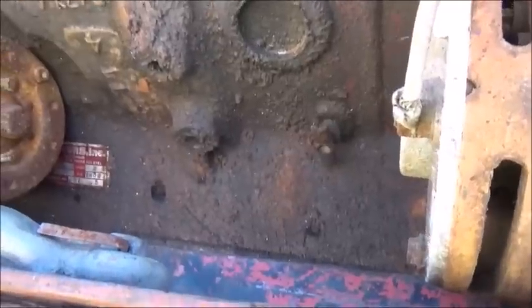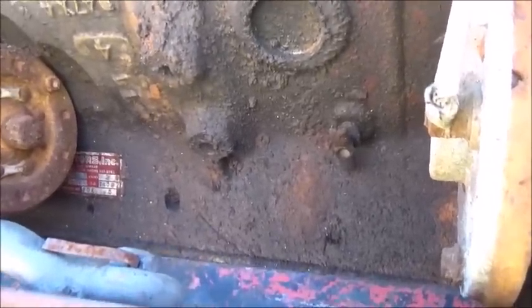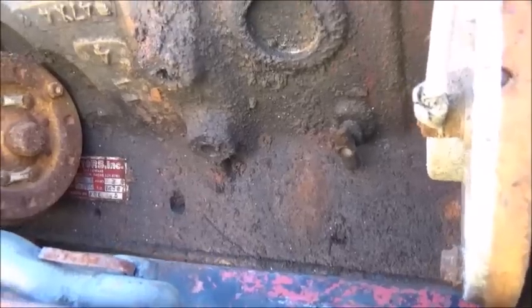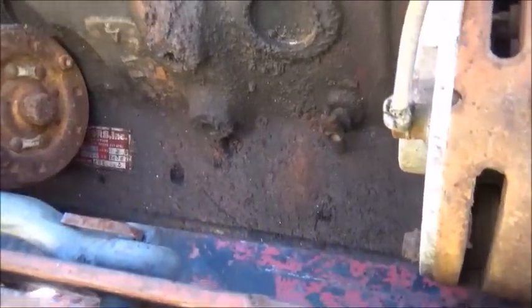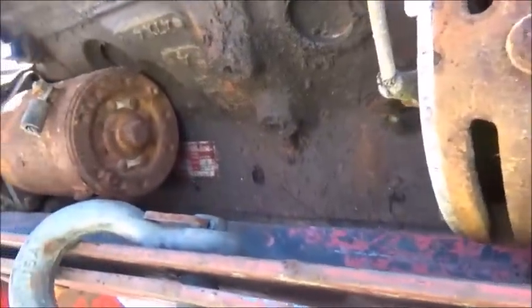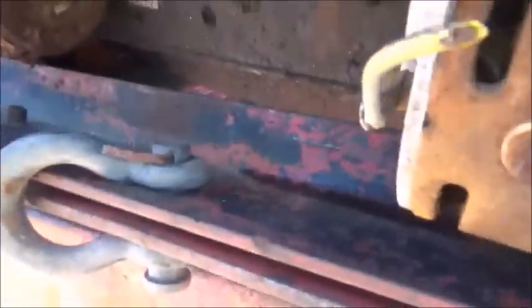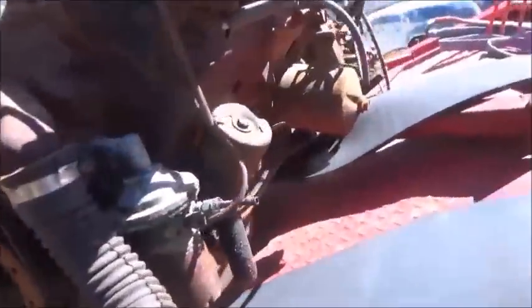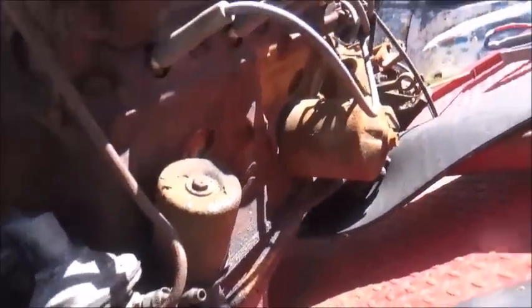When you start turning them down that far, you know the 30 is undersized, not oversized. You've got oversized bearings, but you've got an undersized crankshaft, so you start getting into issues with making a weaker crank. But I don't think it's that big of an issue on this engine. I would say the cranks are probably bigger than what they needed to be to start with. Most old engines are that way. I don't think we have any plans to be turning it at 6,000 RPM.